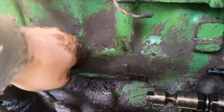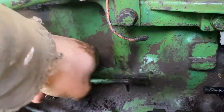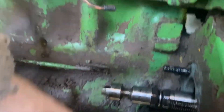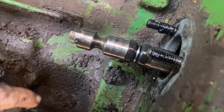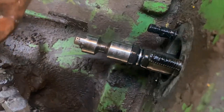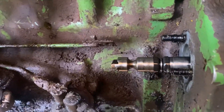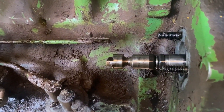Ready to pull the pump. Pump's off. I'll clean it some more. Of course the throttle shaft has a little circlip behind the pump — you can't see — and then there's one, two, three bolts. Last one the stud came out with the nut. And then these two cup seals will get replaced. I'm going to hit it with some brake cleaner, clean this up and then get on to the pump.